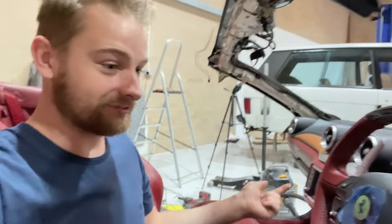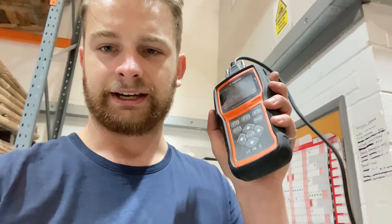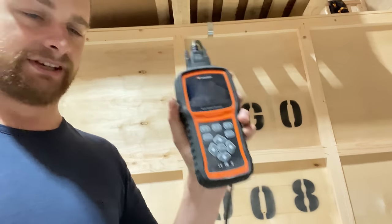Dash is in — really happy with the results. I've got two more bolts to go in down there but at the minute I can't get the door properly open because of the post, so I'll have to wait until I can move the car forward. I can't start the car without removing the crash data, so I need to get those coded off. The airbag light is still going to stay on because the seat belts are locked out — they're still stuck — but I should be able to remove the codes at least for the crash data so I can get the car moving again.